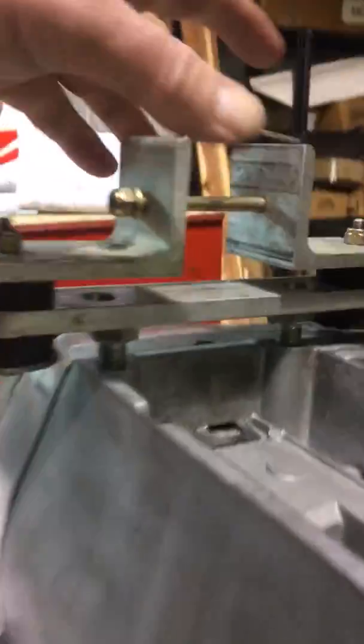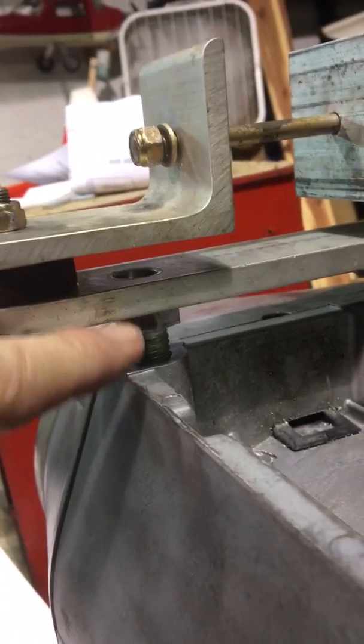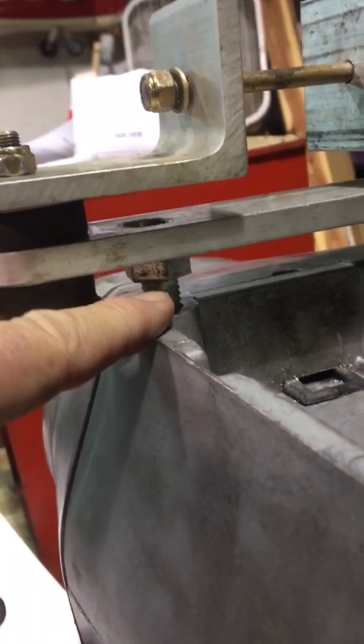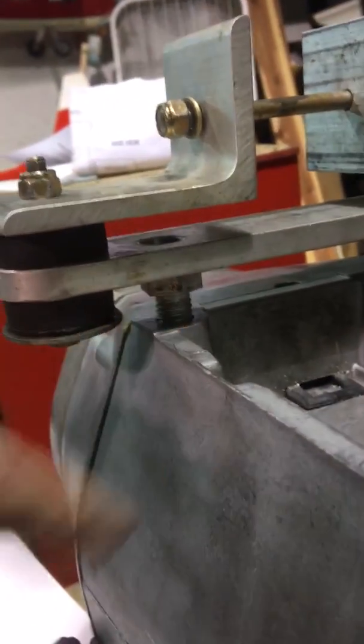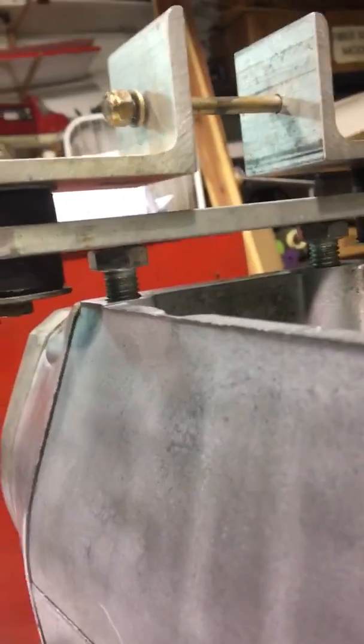Anyway, that's what I've got so far. If we put bolts here that would go through those holes and mount solidly to this bar, and then put spacers here — washers or something — that might cure the problem. It's just going to lower the engine down maybe three quarters of an inch. So think about that and let me know.